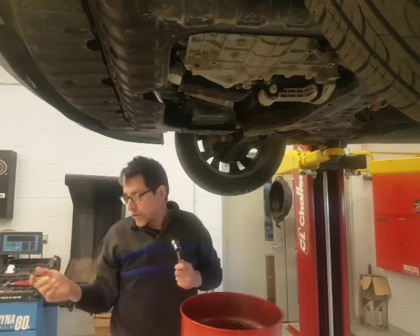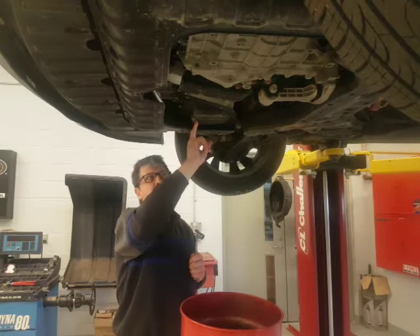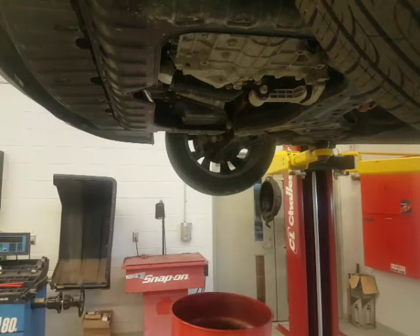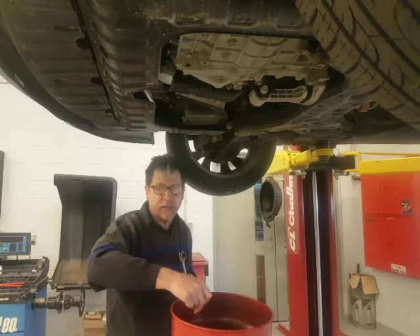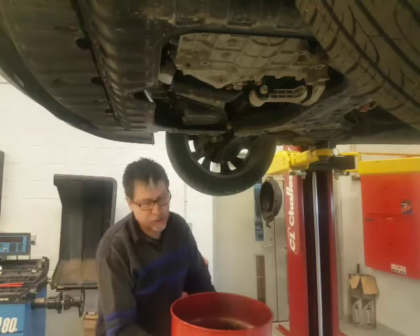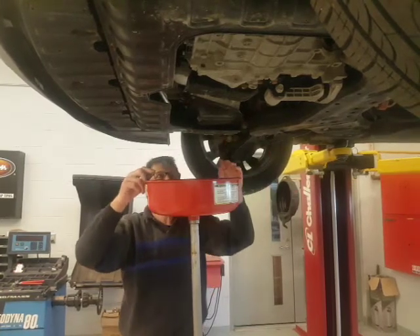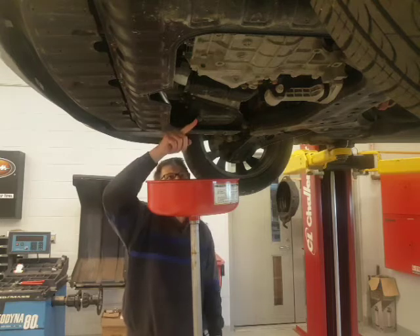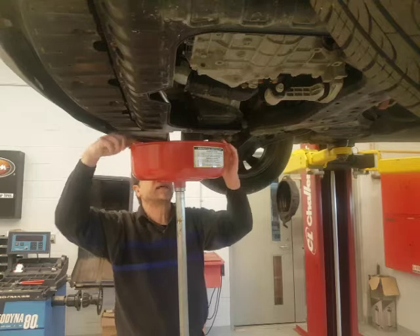We know the torque — it's only 30. There is an aluminum washer on here; a lot of cars have some sort of washer. If it's not built into the drain plug, it's sitting on there separately. Make sure you don't lose track of that washer. I found one in the drain pan from a student's Honda Civic that had a slow drip because he forgot it. So if there's a washer, keep track of it. Now, we use this oil catch — we know the oil is going to shoot forward when we remove the plug. Position the catch accordingly. When you pull the plug, just move your hand up because the oil is going to go down, and there shouldn't be too much oil on you or the floor.